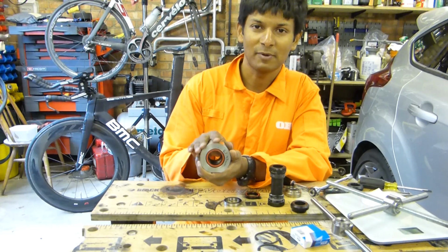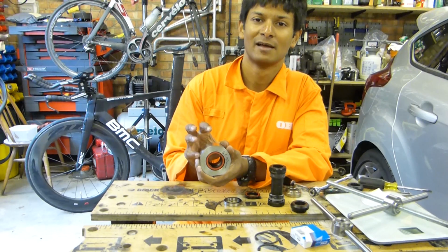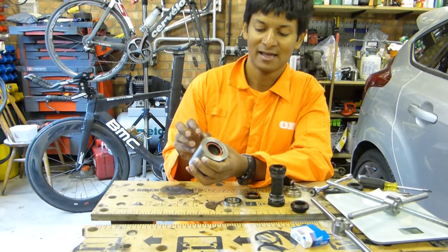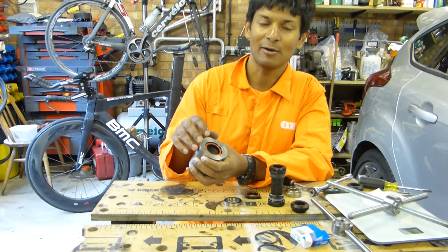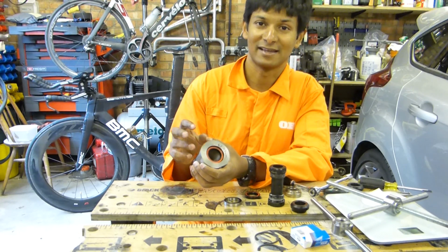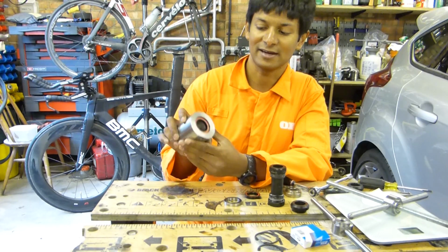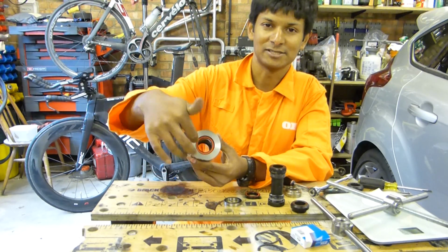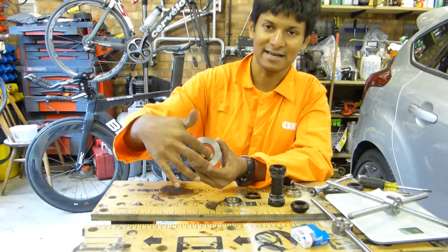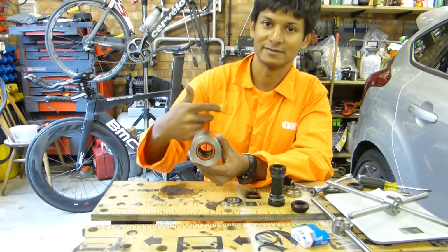Now, my bottom bracket shell is precisely machined in metal, and therefore you can obtain very, very accurate manufacturing tolerances. When they do this in carbon, the manufacturing tolerance they can obtain is not as accurate. It's just the nature of the material. And the other thing is the way this is manufactured. So when I made this, I drilled purely from one side to keep everything in line. So I drilled that side, carried on through, and then drilled the other side, but only from one side.